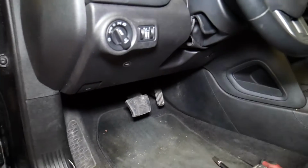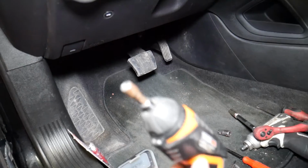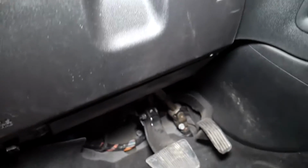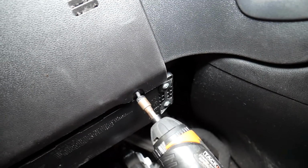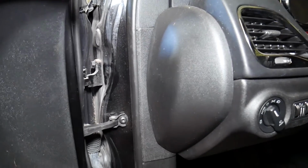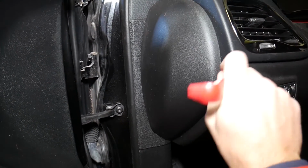So what we need to do now is get a 7mm socket. This is a 7mm socket right here with the electric screwdriver, so it can save us a little bit of time. If you come under the steering wheel right here, there is one screw that we need to remove. You can see this one here. Perfect, this one's coming out. Now what else we need to do? Right here, we have one cover that we need to pry open. I would recommend using only plastic panel removal tools. We have the link in the description of the video below.